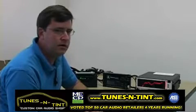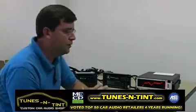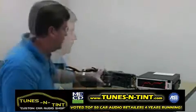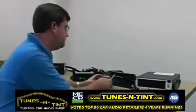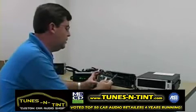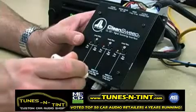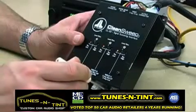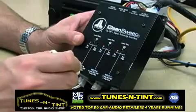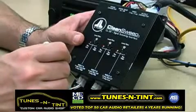That's really critical, especially on that Saturday afternoon where we're trying to get out of there and we need to get this car done. We'll pull our CLSSI up front here. We're going to plug the sub-signal coming out of the radio into the subwoofer input, the rear signal into the rear high-pass input, and the front signal into the front high-pass input.